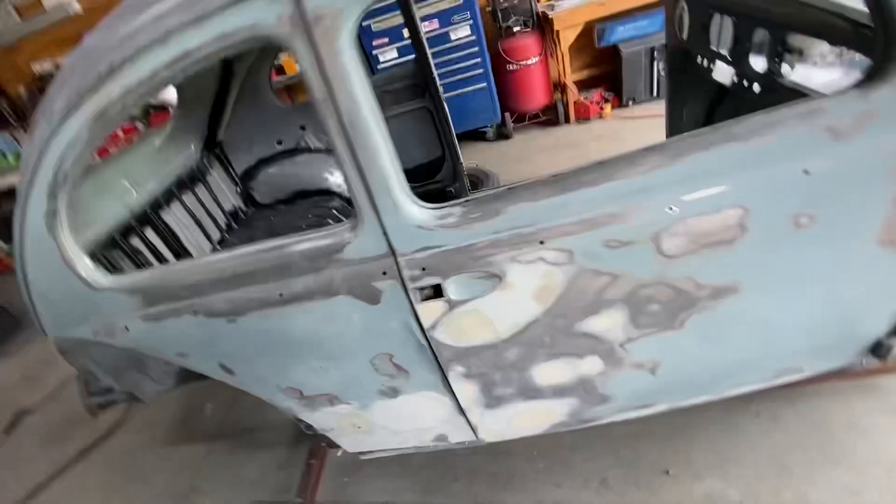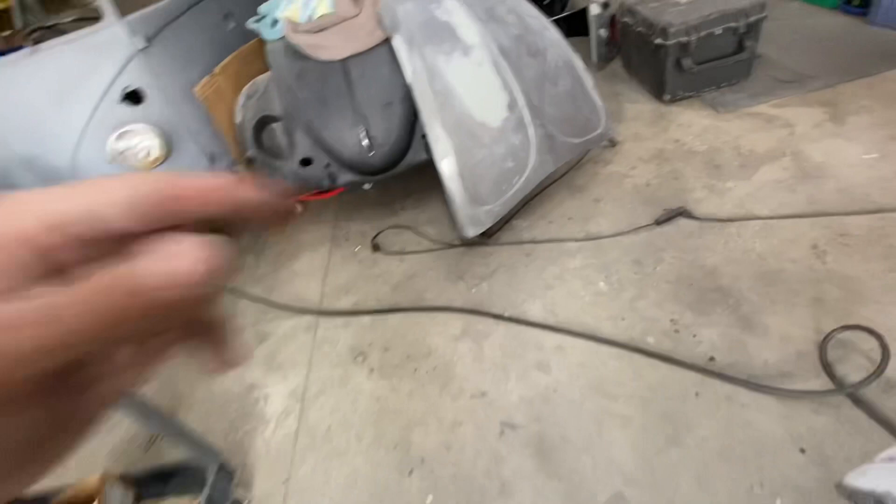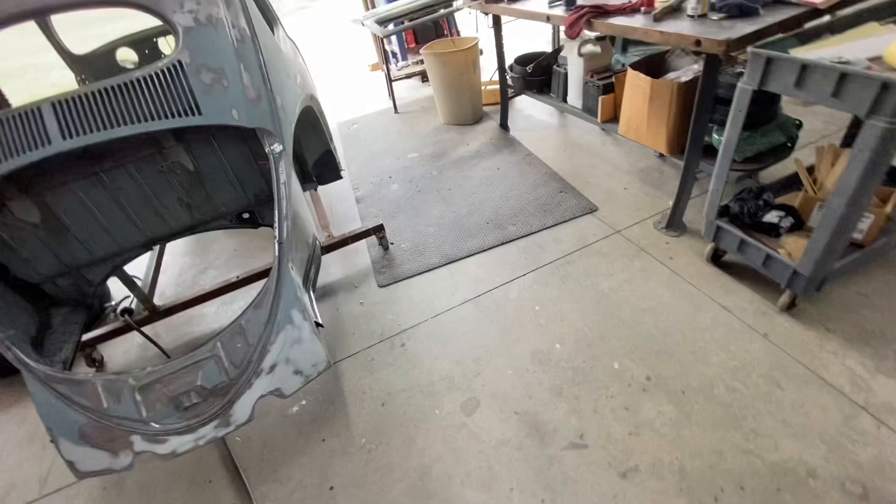I sanded the fender with 180 and the roof is sanded with 180. Everything back here is sanded and done. The door is done. All I've got left is to get this hood back on the car. I've got two rear fenders I need to put on the car to look at them, sand them down, and see if they need filler — but it seems like they don't need much. I think the primer is going to take care of that. That fender is done so I gotta put it back on the car.